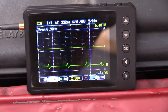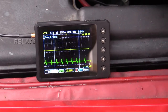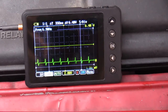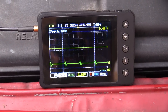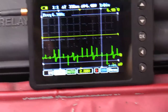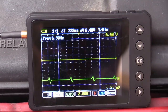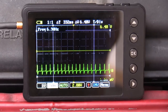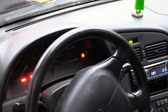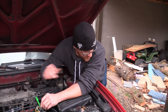Look at that one! Can you tell me if the check engine light's off right now? Still on. Tell me if the light's off now — that's with the capacitor. I can definitely clean it up. Tell me if that check engine light's back on. The fact that that light is on right now with me filtering this signal and it being nice and clean is telling me that this signal is just too weak to be seen at idle.